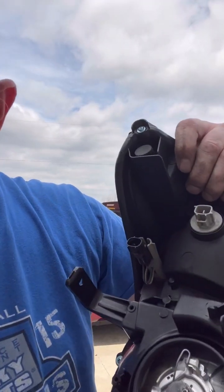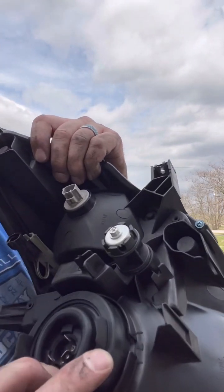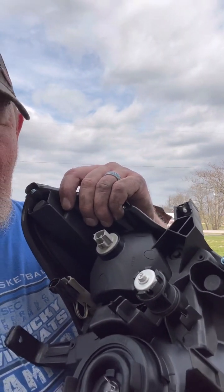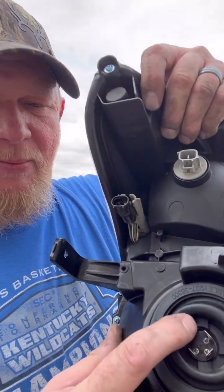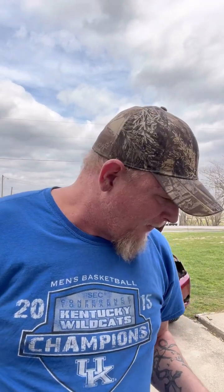Make sure it's secure. Put your rubber boot back on — it keeps all the moisture out. Push it down around the bulb to create a seal around the back of the bulb so moisture doesn't get into the housing. A lot of people ask, why am I getting water in my new headlights? Are you putting all the rubber seals back on the bulbs? Probably not. Make sure you're not leaving them on the old light — that's the problem a lot of times. If those seals don't get replaced, you're going to get a leak.